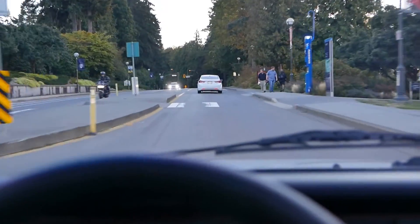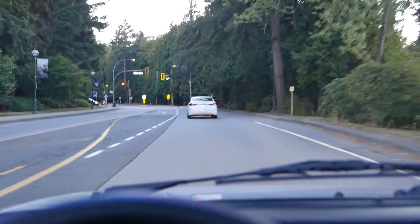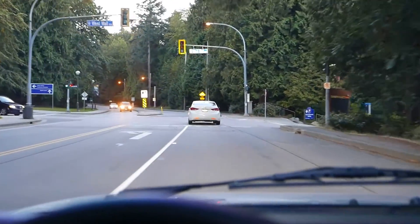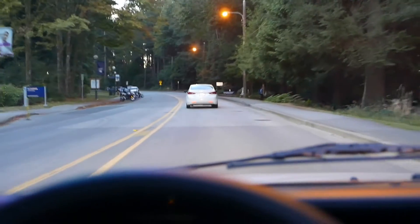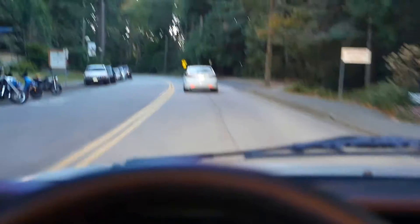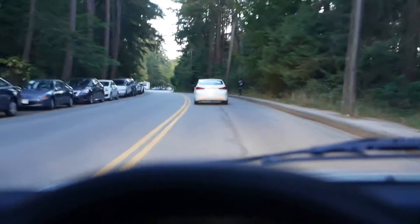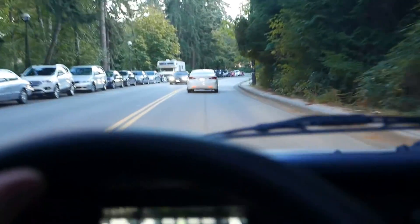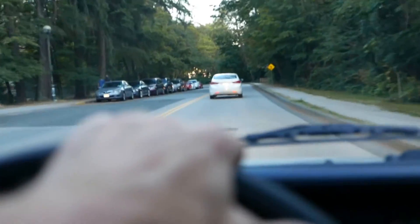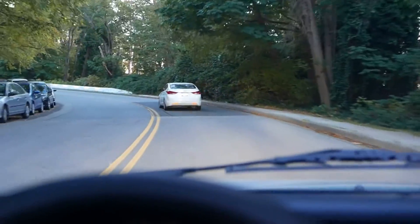I'm super happy that I had the mechanics go completely over it and confirm this thing is solid and works. Now it's up to me to get it properly licensed and do some performance benchmarking. I think I'm going to keep the springs that are in it - I don't even think I'm going to put a front sway bar on it because I've got that AutoTech hollow rear bar. The stiff front springs and racing struts aren't that punishing, they keep the car nice and flat, and I'm not getting any body roll at all.